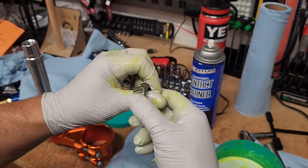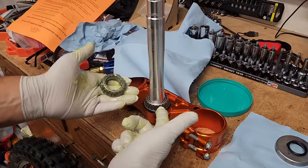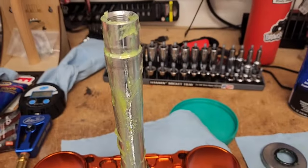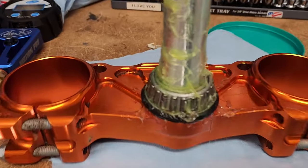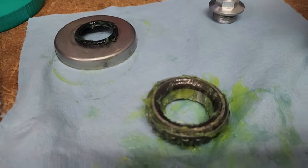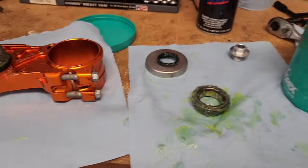Just keep working at it until you feel like there's plenty of grease in there, then do the same to the other one — though we'll have to work it while it's still on there. Here we are: I've put a little grease on the shaft to protect it from corrosion, thoroughly worked grease into this bearing, and thoroughly worked grease into that bearing.